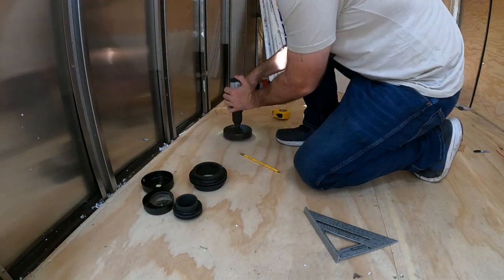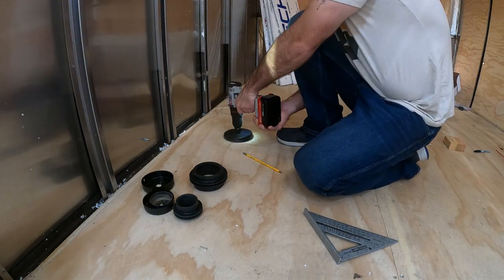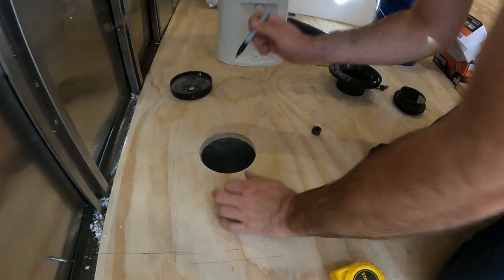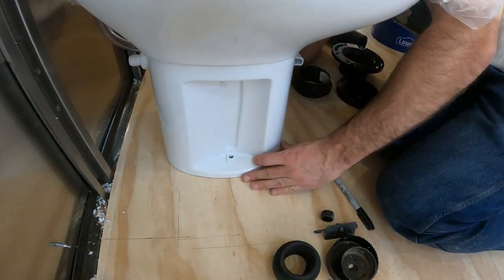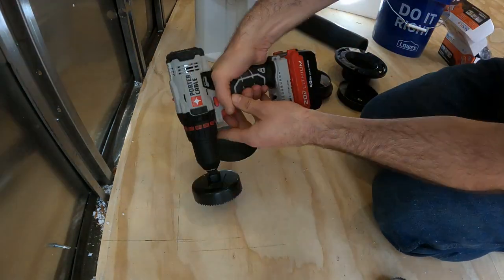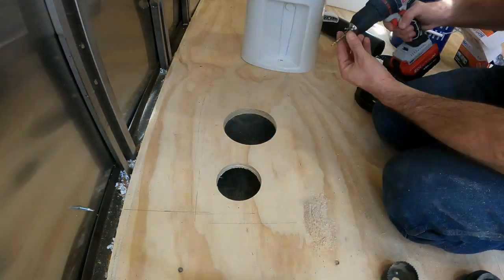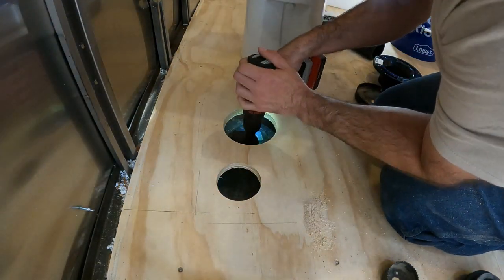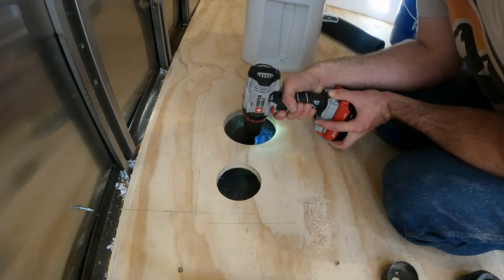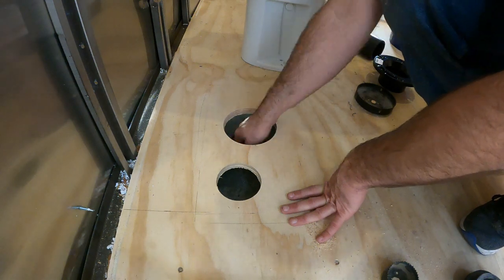This requires a hole through the wooden floor, then a hole into the waste tank which will be sealed with a grommet. The vent hole is pretty close to the shower and the toilet, so this is going to be a pretty tight bathroom. Once I get the floor holes drilled, I work on drilling pilot holes for the tank holes, clear off the burrs with a knife, then dry fit the grommet.